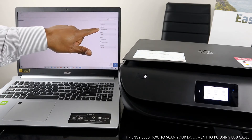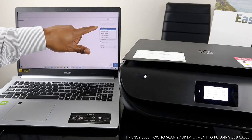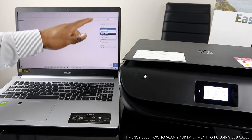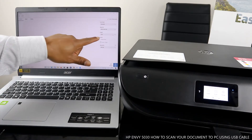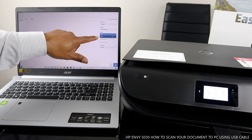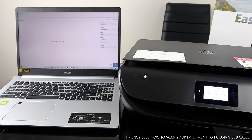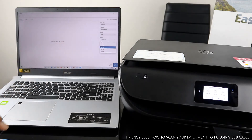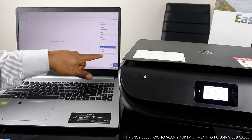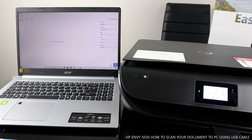Select the page area. For color output, if it's black and white select Grayscale; if it's color, leave it on Color. You can also change the resolution — you can increase it to 600 dpi or 1200 dpi. We'll leave it at 300 dpi.